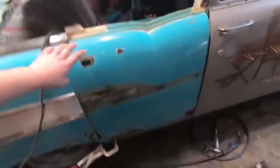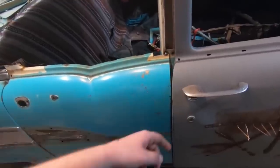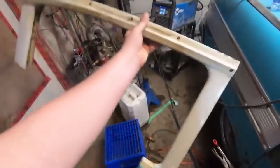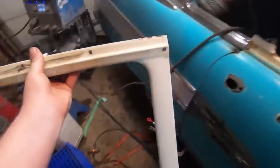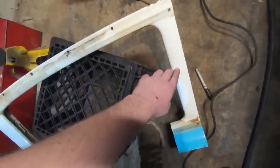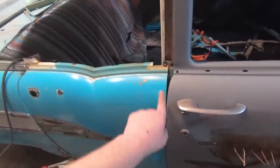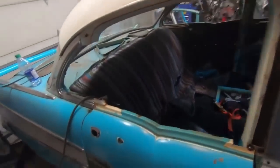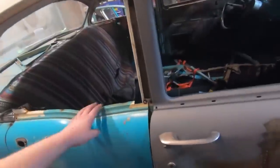It's been about an hour. I skinned the door, got it in place with a few tack welds, so it fits not bad. I got this gap here which I planned for this time. I still got to make this piece fit — I cut it so when it goes on I'll just blend it in. This piece I'll probably have to cut into a few strips. I end up cutting it kind of there, and I might cut it right in the center on this one, add a piece. Then all the guts out from the inside and trim this up a little bit. Making some progress — it should be tacked together in another hour or two.